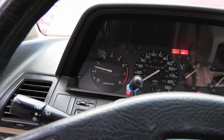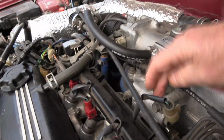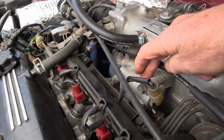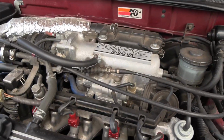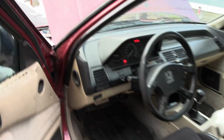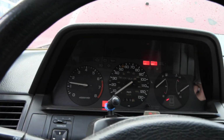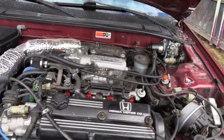I hope that helps somebody that was looking to know which one was which. And actually, I've got a couple of these idle air control valves from other cars out in the shed, but this one here I got, it's aftermarket, at AutoZone. Must have been, I don't know, 5-6 years ago. I still kept my old one, and you can clean them up inside and maybe they'll still work. So keep that in mind. You just use some electronic cleaner, because there's plastic in there, so using carb cleaner or something like that on plastic is not always a good idea. So the CRC electronic cleaner is safe for plastic, and it cuts the stuff out.